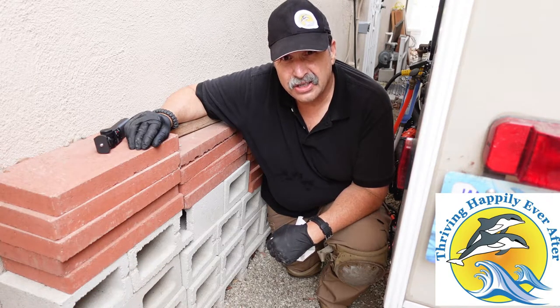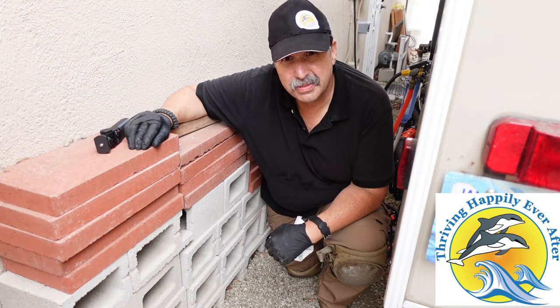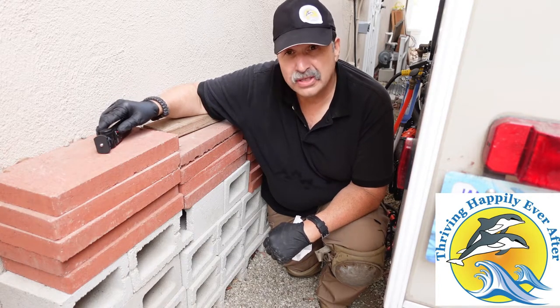So I'm going to do two or three more cycles till I start seeing that water come out clear, and then we're going to have a look at the gauges. I'm going to run about a minute and a half, or 10 gallons of water — still only a third filled on the black tank as it applies to this particular rig at 33 gallons.